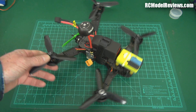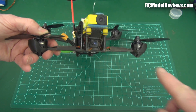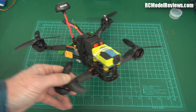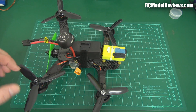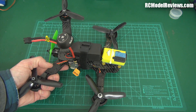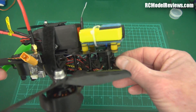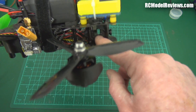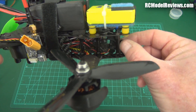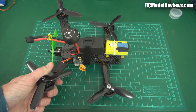I went out, I plugged it in, and no picture from the FPV camera — this little FPV camera here — no picture. The video transmitter was working, I've got a black screen, but there was no video and I couldn't see any obvious breaks in the wiring. The wiring goes all the way through into the camera. What I did notice was that when it came, there was a lot of stress on the wiring in the camera. This receiver was pushing into it and causing a lot of stress on the wires. Maybe it's broken a wire where it goes into the camera. I don't know, but I couldn't fly FPV.